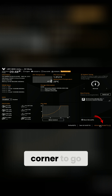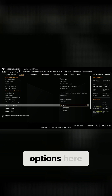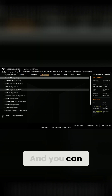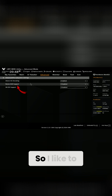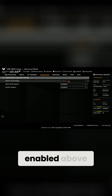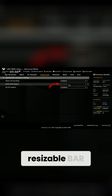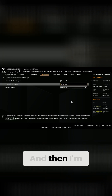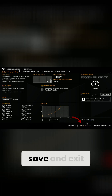We can hit F7 or tap in the bottom right-hand corner to go to Advanced Mode. Under Advanced Mode, tap on 'Advanced' and come down to 'PCIe Subsystem Settings.' This allows you to turn on Resizable Bar. I leave the top option — Above 4G Decoding — enabled, and then under it we have Resizable Bar Support, which is disabled. Go ahead and set it to Enabled.